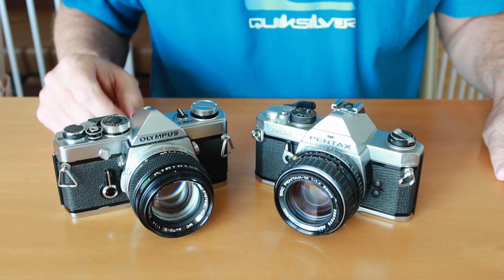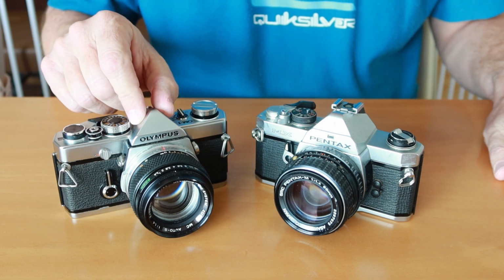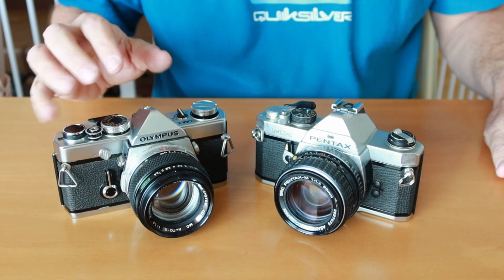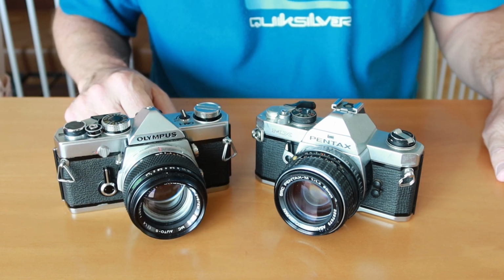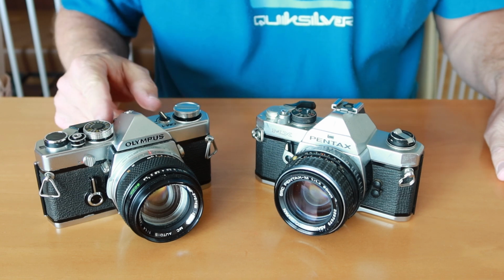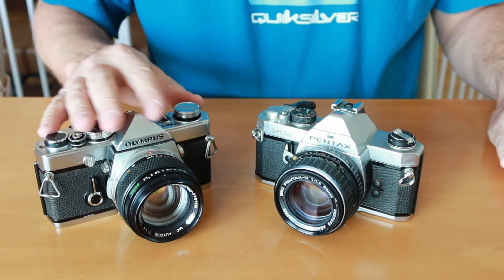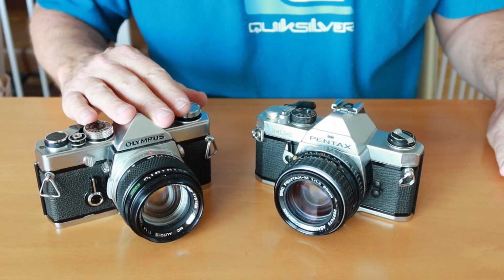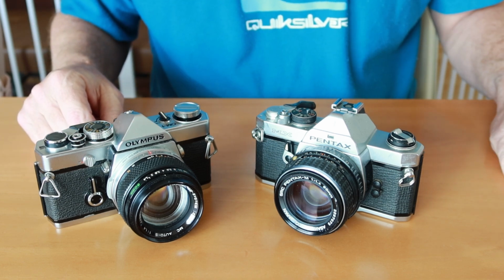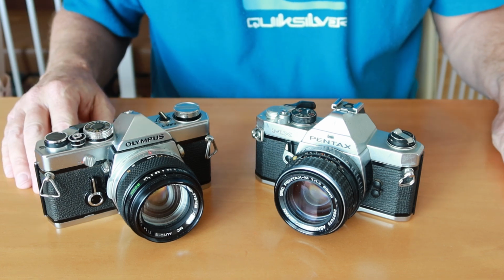But the issue is that the chemicals in this foam rubber break down and etch into the coating on the prism and cause these hideous black splotches. So if you're shopping for one of these cameras, always take a look through the viewfinder to make sure that there's no deterioration. You usually see it around the bottom. It's not difficult to change the prism in one of these cameras. You can do it with basic hand tools, and I have a video on my channel somewhere showing how to replace the prism in one of these cameras.